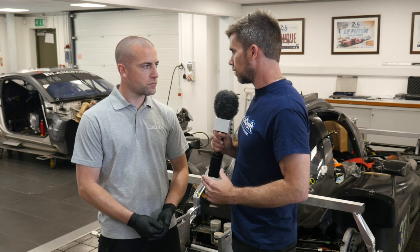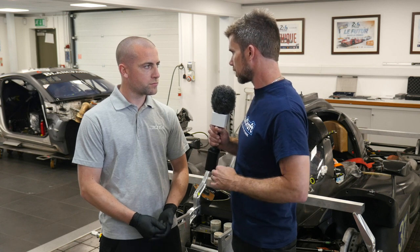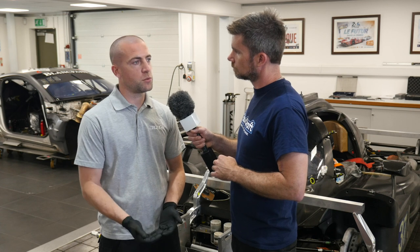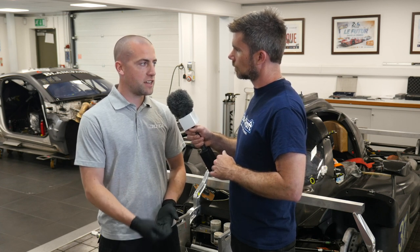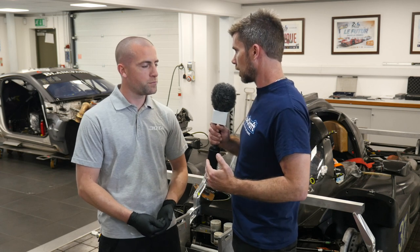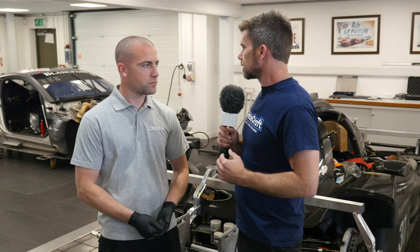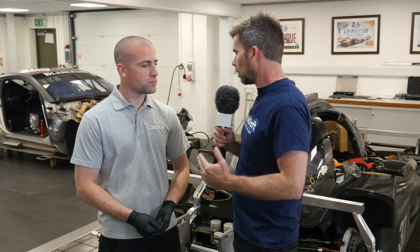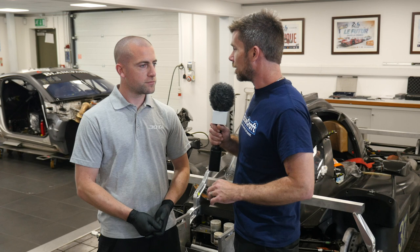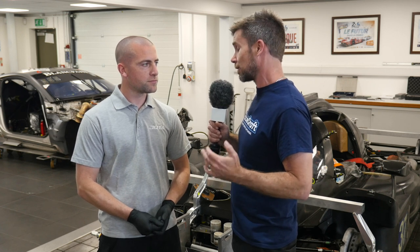The last point is ride height. Is there a minimum ride height specification, or is this a personal setup choice? It's a personal setup, but due to the skids underneath the floor, if the car is too low they'll wear excessively below the limit and the car will be excluded. There isn't a minimum ride height as such — it's dictated by that skid wear. The skid on the underside is essentially a motorsport-grade plywood: you start at 25mm thickness and can run down to 20mm as a minimum. While this setup is at the LMP2 level, it's still totally applicable to everyday street cars and those attending track day events.